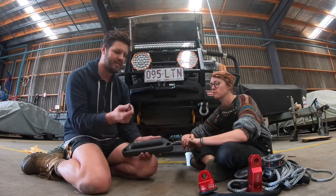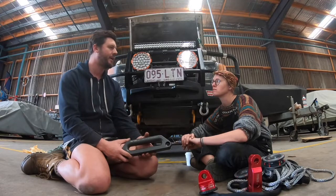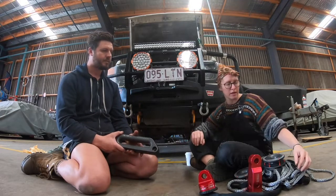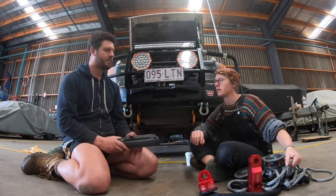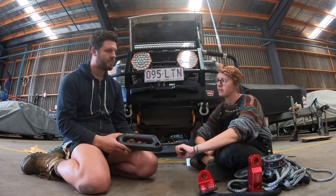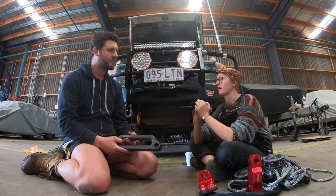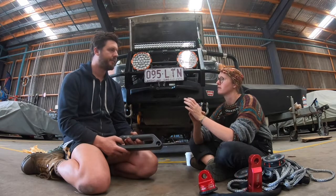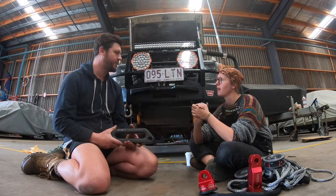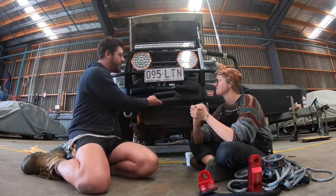Over time, even as that rope gets dirty and gritty, as it's dragging across the fairlead pulling quite hard, it's not going to scratch that surface. Furthermore, this rope is made out of so many tiny fibres, and they really do catch on everything. On a poorer quality fairlead with scratches or minor abrasions, the rope would catch in that and just cause you grief. So a good quality fairlead, I thought, was fairly essential — it's part of the vehicle and it's going to stay.